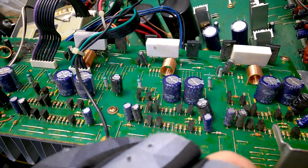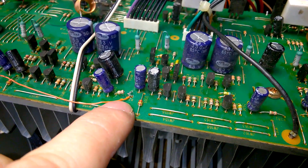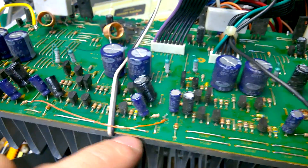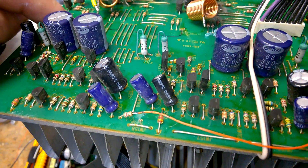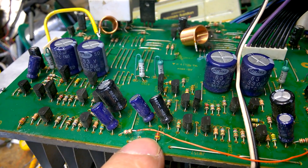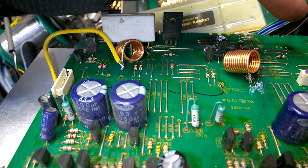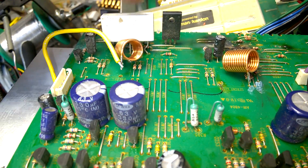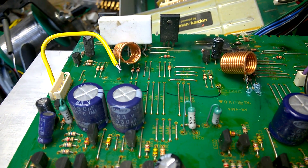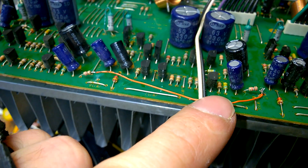Here is my solution. There are five complete identical amps. I have wired the input from the left channel, which is broken, to the rear left channel, which is 100% identical. I have removed the signal coming from the surround board and wired the output from the broken channel to this channel here. This should normally work — we will see it in a minute. The wiring is a temporary solution; I just want to see if this is working.